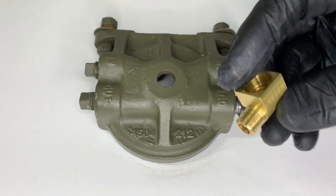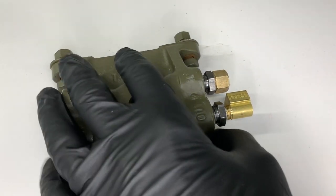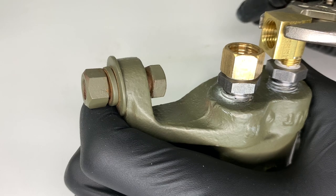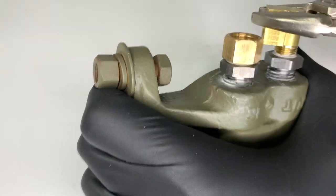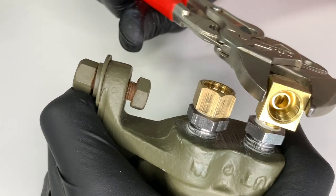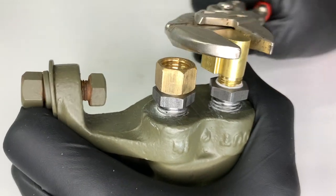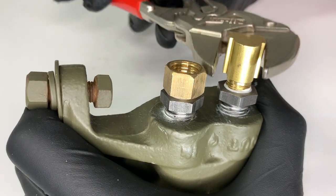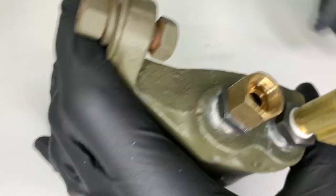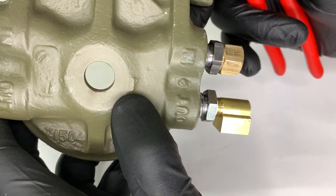The last fitting in this video is the elbow — the 5/16 inverted flare tube elbow. Sealant goes on the threads the same way as the other fittings. I've got a special pair of Knipex pliers that are almost perfect for odd-shaped things with no slippage. You're going to want to hold the wrench on the fat meat of that elbow — don't put it in the center where the opening is for the flare fitting, or you risk damaging that very thin part. Stay on the outside, tighten it down until it just about seats, and you want it facing forward toward you. That elbow goes on the outside of the cap.